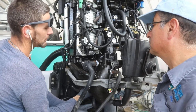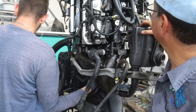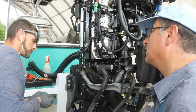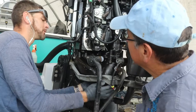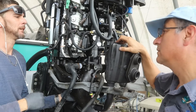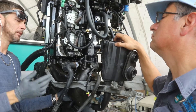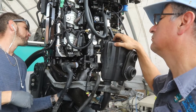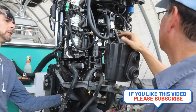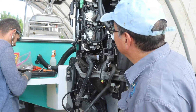This one has a brand new powerhead and a brand new adapter plate. The previous powerhead had multiple issues: a leaking lower crank seal, it needed an engine harness, the flywheel and stator were destroyed with all the magnets spun out, it needed an oil manifold, and all the cylinder heads were leaking. The customer has 700 to 800 hours on it.